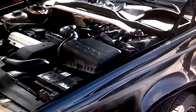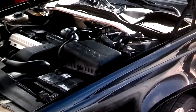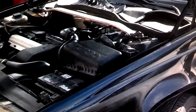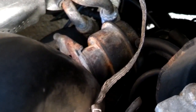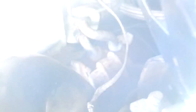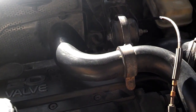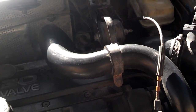Due to the fact that I'm under boosting, I believe I may have a problem with my bypass valve — either broken or has a leak in it. So I'm going to try to pull vacuum on it and replace it if necessary. I hooked up a vacuum pump to my bypass valve — blow-off valve they call it — and I had zero vacuum on it. I went to the salvage yard, pulled vacuum on the bypass valve there, and I got a lot of vacuum. So I'm going to assume my diaphragm is torn.